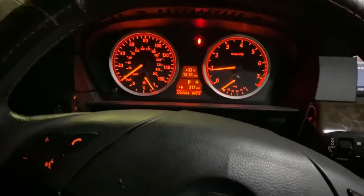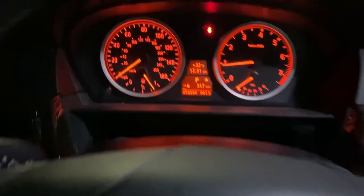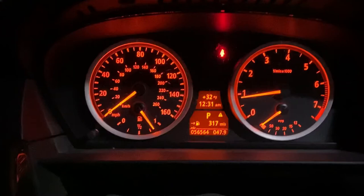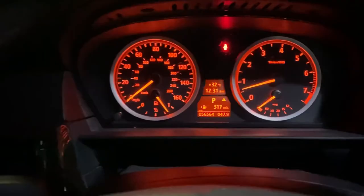As you can see, the dynamic stability control sign is no longer shown. If that doesn't work when you turn the steering wheel a few times to the right and left, drive around the block once or twice for a minute or two, then try again — turn it all the way to the right, cut it, then all the way to the left. The 4x4 and dynamic stability control signs will be gone automatically.